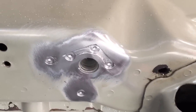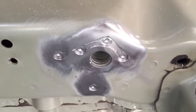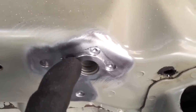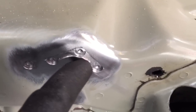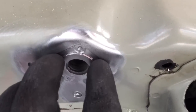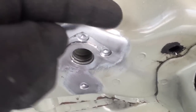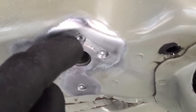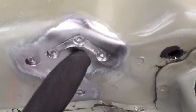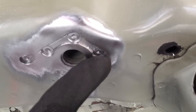So that's the left front mount, partway through the removal of the crack problem and drilling out of a spot weld. So two spot welds that had shown signs of flex moving, and proving that there was a semicircle crack around this center point, as we then drilled three spot welds with 8mm spot weld drill bits, and then also made an incision on just this outer side, which then the piece of metal in the middle has fallen out. And that's proved by the fact that I don't know of any machine that can cut a circle like that, so that circle was a crack.